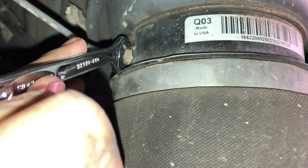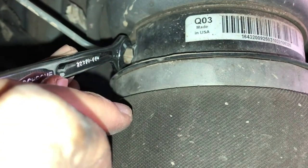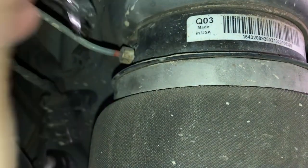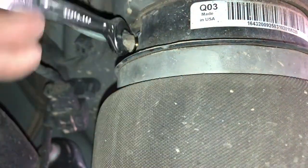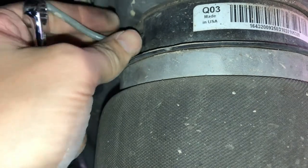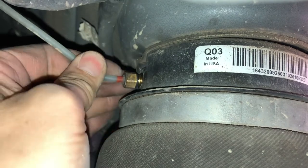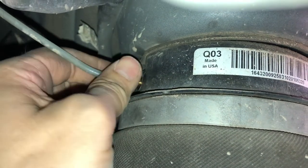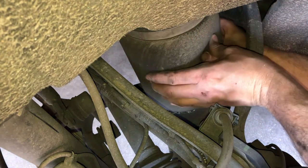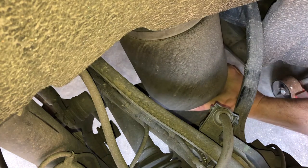What I'm going to do is take a 10mm spanner and crack that air line, let the air pressure out of the air spring, and then I'll remove that fitting completely. There we go. Now that I've deflated the air spring, you can see that you can really push that bag in and straight away it comes up from that bottom cup.